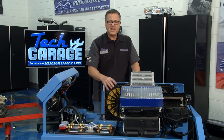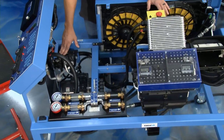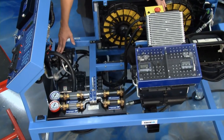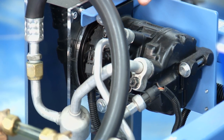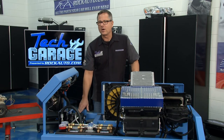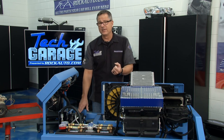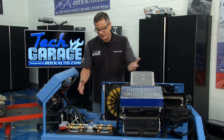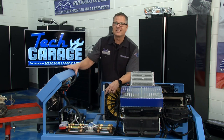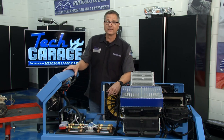Just by feeling those lines, you can tell what's going on. Our car didn't have a pressure problem or a temperature problem. But if that clutch or bearing starts to fail, you'd probably see the low side at high pressure because it's not pulling, and the high side at low pressure because it's not pushing — that's a good look at the AC cycle, and you're only going to see this here on Tech Garage.